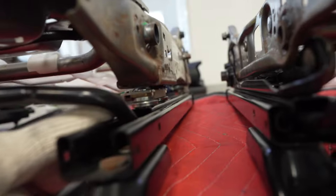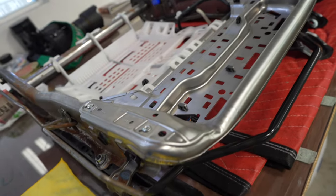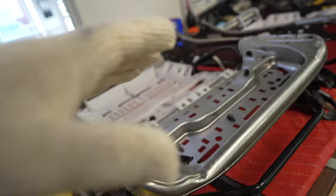On the passenger side it's more complicated — it's a load-bearing sensor system. There are two sensors, one at the front and one at the rear, connected to the actual rail itself. The Honda system measures weight in real time: it knows when somebody is on the seat and adjusts based on how heavy the occupant is. Compare that to Nissan, which uses a bladder system — basically a trigger that turns the airbag on or off based on a weight threshold. Honda's is a lot more complex, which is why it's harder to work with.